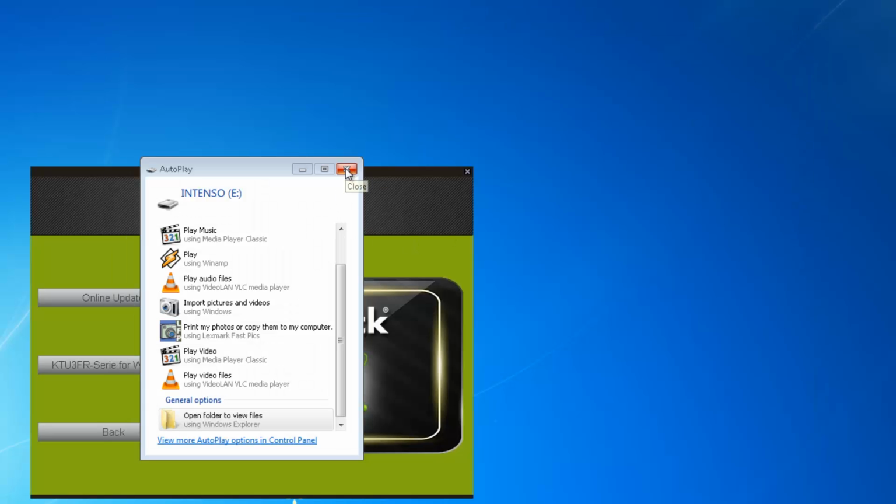Now it'll also work with external hard drives and all that stuff as well. So it's backward compatible to USB 2 and USB 1. So you should have no problem with backward compatibility. Now certain products just will not work with USB 3, so just be aware that some flash drives won't work and some external hard drives won't work either. It'll all depend on their software and hardware capabilities. Okay.